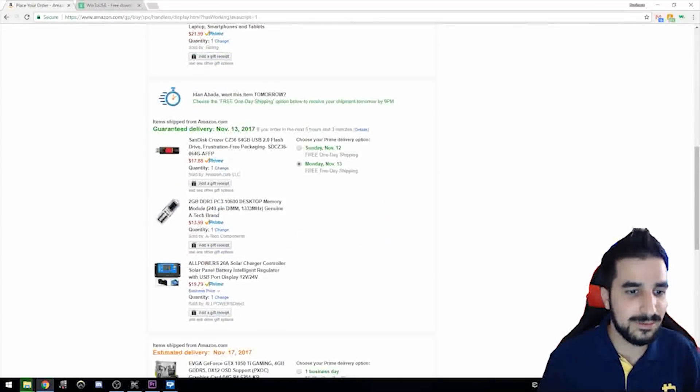That's the full parts list — everything you need to create your own solar mining experiment. The computer is finished, running Windows from the Win-to-USB drive, a bit slower than an SSD but drawing less power. I also underclocked the RAM to 800 MHz to draw less power even on idle — trying to minimize everything so the main power draw is from the video card, which is what generates the profit. This project required all my knowledge: soldering, amp and wattage calculations, battery sizing — everything.